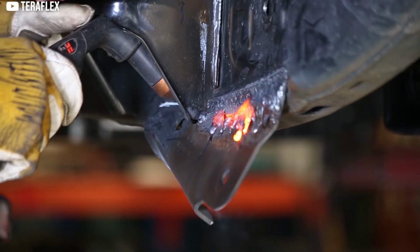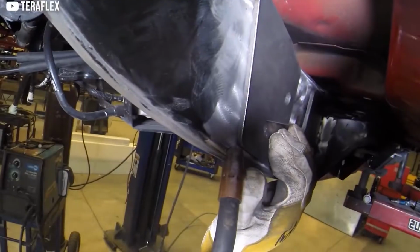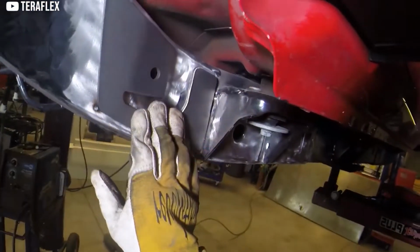Another negative aspect of long arm kits is that once they have been installed, it's tough to go back. Installing a long arm lift usually means cutting off the stock brackets and welding on new brackets further back along the frame of the vehicle. Going back to a short arm lift after that is not only labor intensive, but costly as well.